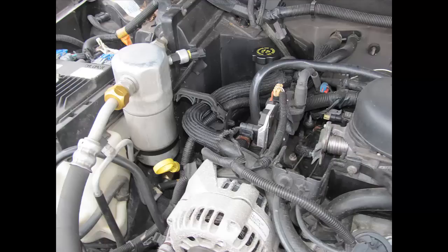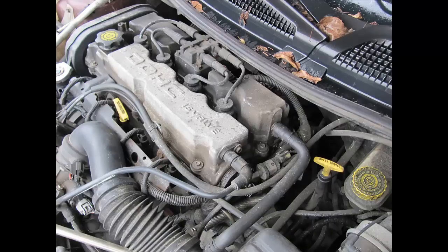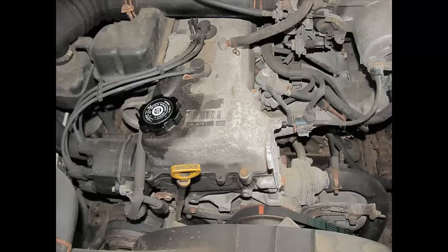If you notice that yellow handle — that's your oil dipstick. This happens to be a Chevy Blazer. This happens to be a Saturn S-Series — again the yellow handle, stands out like a sore thumb. This is a Dodge Stratus — again yellow, but there are two of them: one says transmission fluid and the other says engine oil. This vehicle is a Toyota pickup truck — again the yellow dipstick. Not all vehicles will have a yellow color-coded dipstick; some might be black or have no color at all, so check your owner's manual.